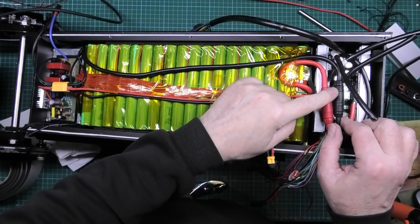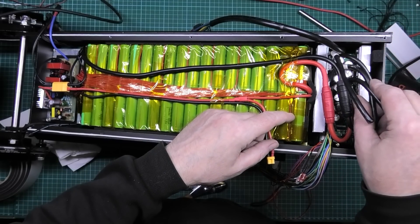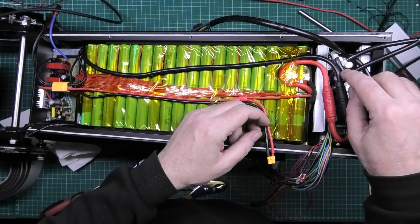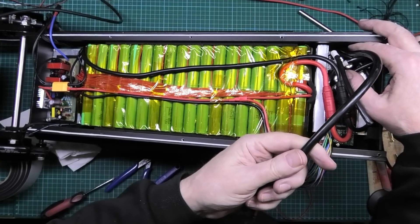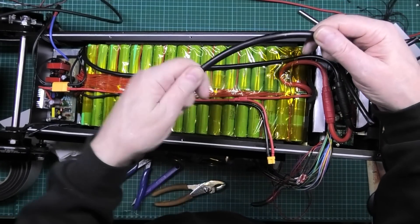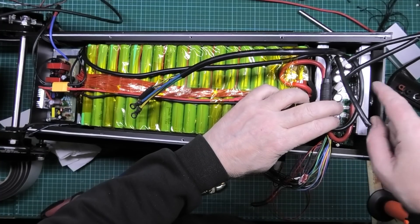I took the QS8 off and fitted XT150s. Along with that I've also had to put silicone wire on the phase wires because I couldn't bend them round enough without them starting to break. I've had to put these on and then label what color they are. Here are the phase wires — as you can see the gap, there's just no space for anything. I've got to wire these up and that's going to be a challenge. I've got a hole there for the wires to go through for the front.